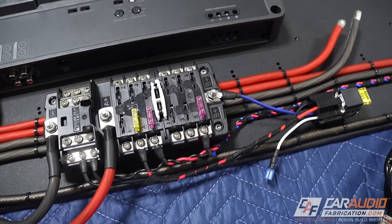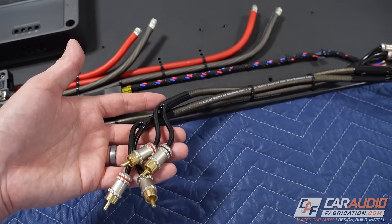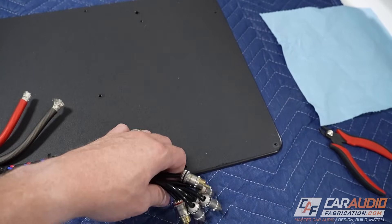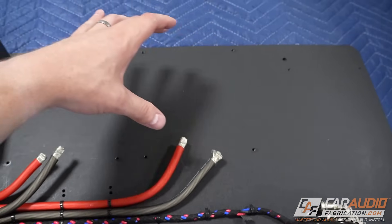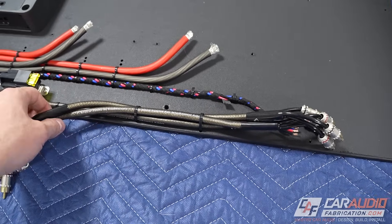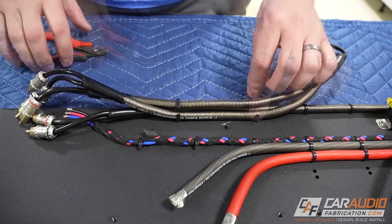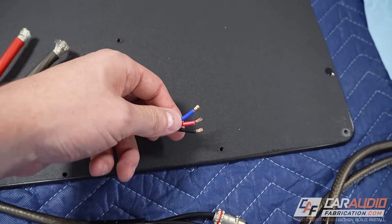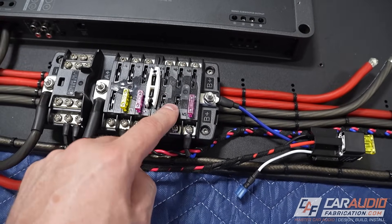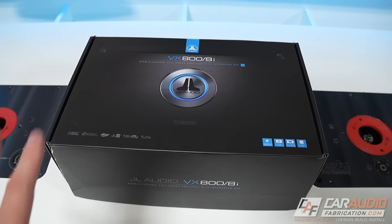There are some RCA signal wire connections still attached that I'll need to undo, as I don't need nearly as many RCAs. Previously I had a digital signal processor that was fed signal from the head unit of the vehicle, and then it had its signal going out to the four channels of amplification along with one leading to the subwoofer amplifier. With our new setup, there's going to be an eight-channel amplifier with DSP built in, and we'll still need to send a signal out of that amplifier into our subwoofer amplifier, so we'll probably keep that wire but get rid of the others. The previous wires going to the DSP — a ground, 12-volt constant, and remote turn-on — can be removed since we're doing something different with our amplifier.